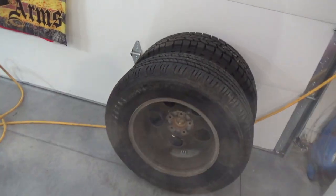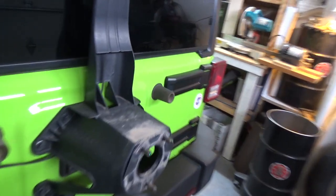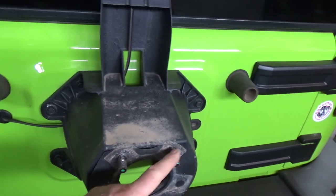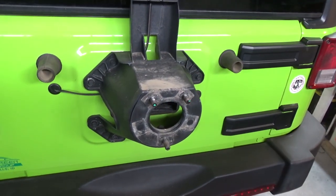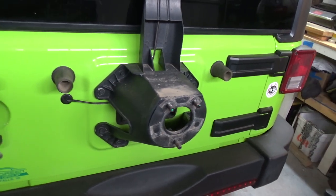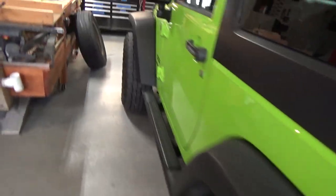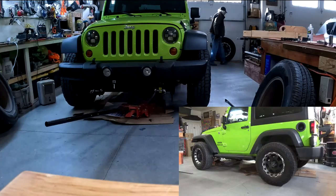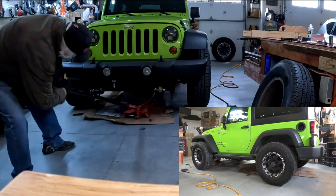So let's get one foot on there — I took that off the spare tire. Now, another thing I'm gonna put on here is I'm gonna put some never-seize on these. Any kind of anti-seize you want to use, put a little on there. It's gonna help it tighten up better and it won't rust on. Let's get back to it. I thought we were just gonna be filming this whole little 15-minute video real quickly.